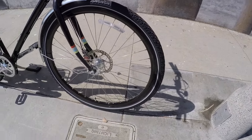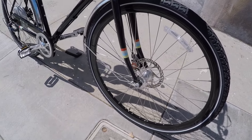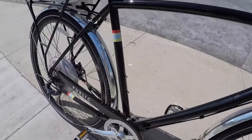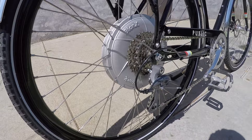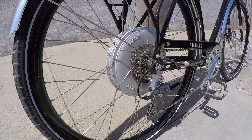It's a nice experience. Even the tires here are a little bit larger - these are Kenda 700 by 42C. I love the reflective sidewalls. I like the painted double wall mid-dish rims too. Up front I think these are like 14 gauge, but in the rear, 12 gauge spokes - a little bit thicker. And that's designed to handle the added weight and power of a hub motor like we have here.